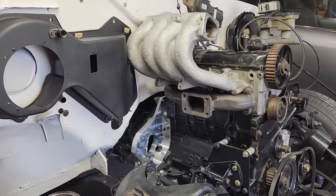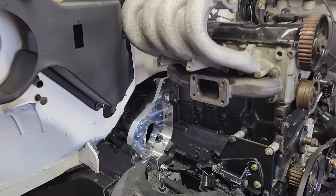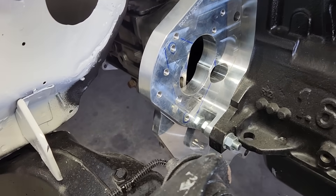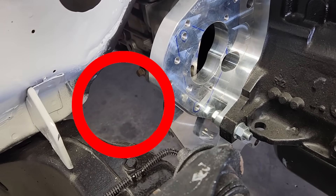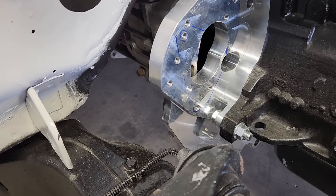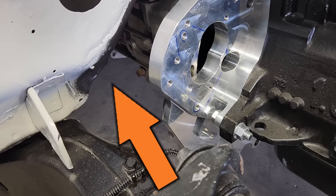One of the challenges we're facing right now is finding a way to route the exhaust system from the manifold to the underside of the truck, and the only place we can go through is this opening. All other pathways are blocked by either the starter or the massive crossmember. This is the only option, and it's not a lot of space. Plus, the exhaust has to do a lot of twisting and turning to get through this hole.